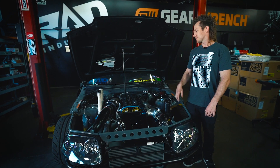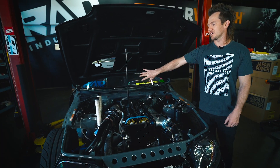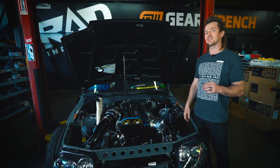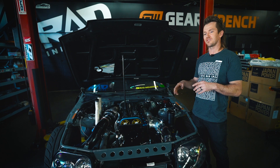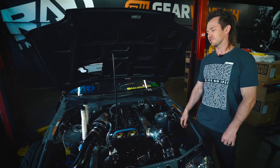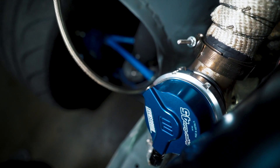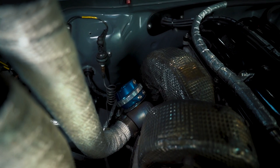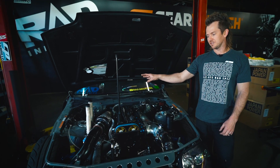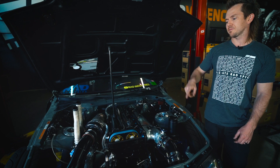Okay, let's go to the hot side of the motor. I run a BorgWarner EFR 9274 — the 74 refers to the hot side, 74 millimeter on the hot side right here. The compressor side is 72 millimeters, so it's slightly confusing — the 9274 doesn't mean it's a 92 millimeter. That's the turbo we use. Super responsive, really like it. Pressure is managed by two wastegates — I run Turbo Smart Hypergate 45s. It's a divided manifold and each section of three runners goes out to its own wastegate. That setup has been working great.